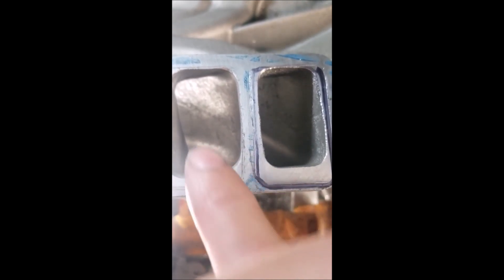There's one right here at the bottom — I'll take off very little here, but I'm really going to take off a lot of material here because on this side, that's the fast side, which feeds into the cylinder wall side on the heads. On the common wall, take off a lot of material here — more than I would on this side.